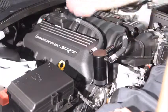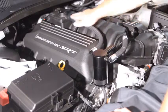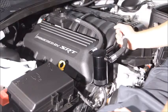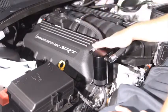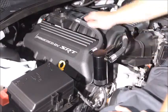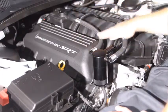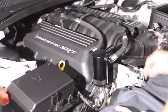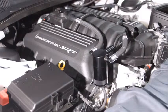You know, pull off the PCV hose up here. You might need to use a little screwdriver like you saw me do to just pry that apart because it was sealed up pretty good. Down here at this elbow, I was just able to twist it out. Cut these up to the length that fits your engine the best. You don't want any pressure on these rubber connectors. This elbow up here, nice smooth transition, kind of keeps it from going out over the engine too much, and a nice smooth path for the oil and air to flow through.